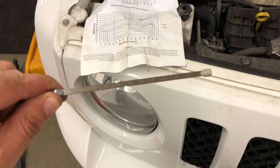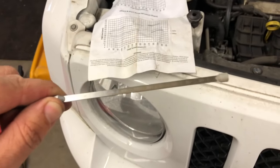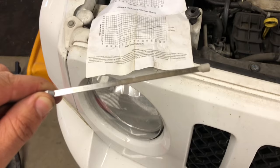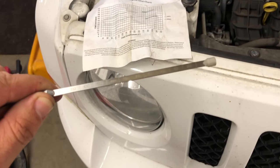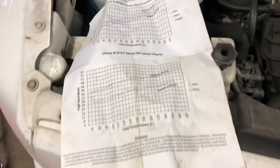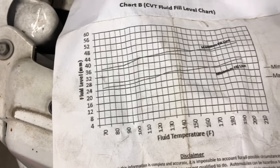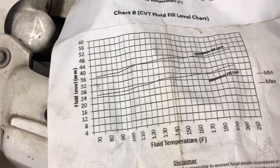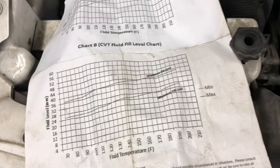Here you can see that dipstick. I hope that's showing up for you guys. Let me make it focus on my hand. All the different millimeter marks. You're going to shove this in that tube till it bottoms out, and then your fluid level will show on this. For temperature, since everything's cold, you know what your outdoor temperature is. If it's 70 degrees, 100 degrees where you live, your car's probably close to that. That'll get you in the ballpark. So that's what we'll do next.